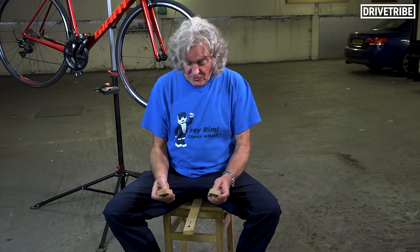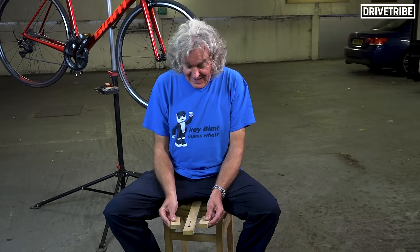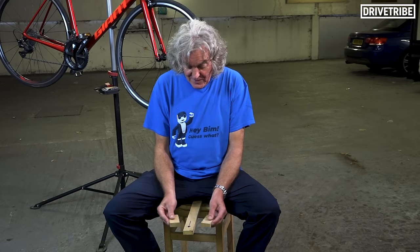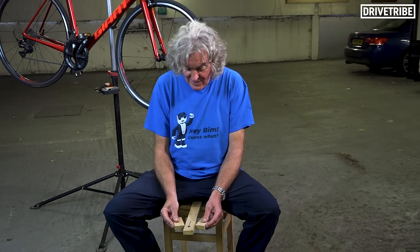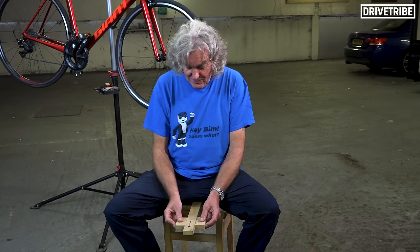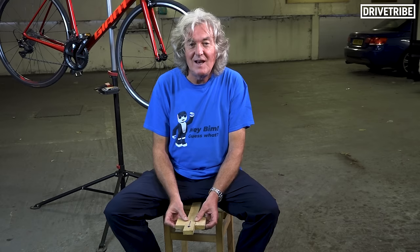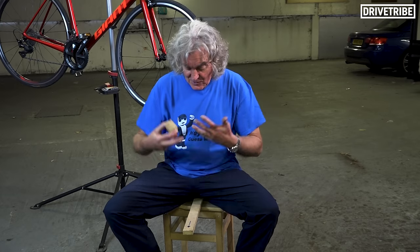So what a lot of serious cyclists say you should do is toe in the brakes — that is, the leading edge of the block meets the rim first. I'm exaggerating greatly here, it's a tiny difference, but the leading edge meets first and then as the rubber compresses and the brake flexes very slightly, the rest of the pad comes into contact. That gives you very nicely progressive, modulated braking, much better feel. And bicycles of course are all about feel — nothing communicates with its user quite as feverishly as a bicycle does.